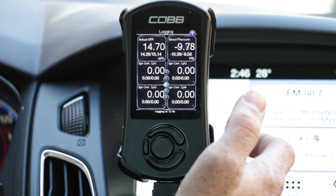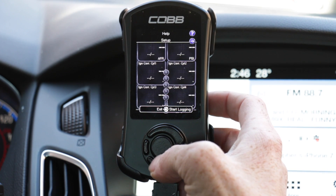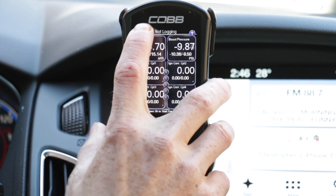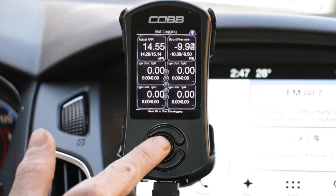Now we know when we go out for a data log that we're not going to have any issues initiating and stopping the log. When you stop the log, it just displays 'not logging' at the top. Notice the lag in the start and stop time of the logs — you want to make sure you are starting your log at approximately 1800 RPM, because you're going to be at wide open throttle at 2100 RPM, and that you end your log at a safe time, meaning after you've hit redline you've had time to conform with traffic before taking a hand off the wheel to hit the center button to stop the log.